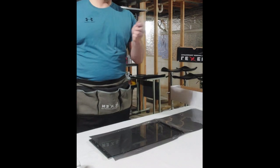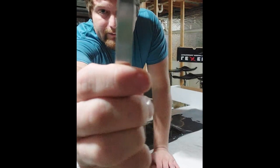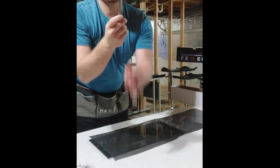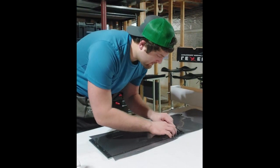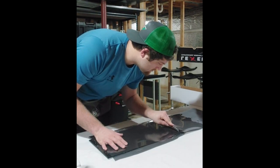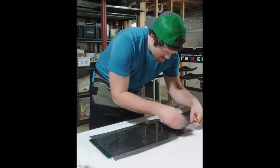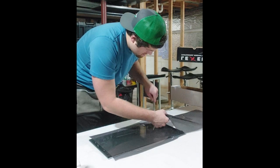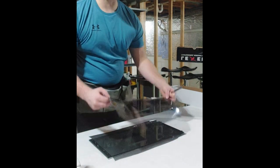So what I do is I take this knife and I go until the blade clicks out just a hair, just like that. See that against my face maybe? That's going to be important, because you don't need any more of the knife out than that, definitely when you're cutting on glass. So we'll put it back in one. We'll stick it out, make our cut. Boom, cut's made. And that's actually big enough. If I mess up, I can do it again.